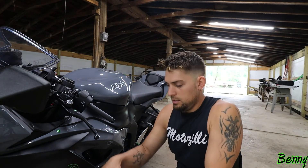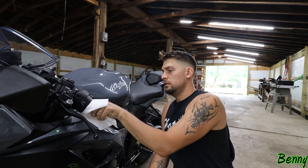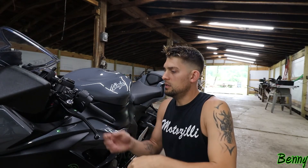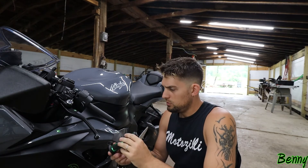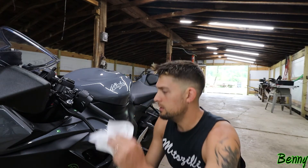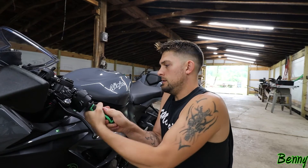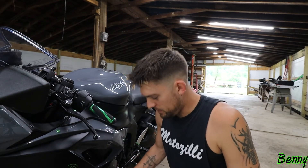There's a tip I saw where you get the bar real wet with rubbing alcohol and then slide your grip on — the rubbing alcohol evaporates, leaving a perfectly dry surface underneath so the grip doesn't spin on you. I'm going to clean it first with cheap 91% rubbing alcohol — all works the same. Nice and dry. Now I've got my new grip, took the end off already. Going to ram this baby on there, get some more rubbing alcohol, get it nice and wet. Look at that — are you kidding me? Like I've done this a hundred times!